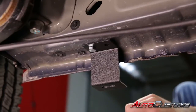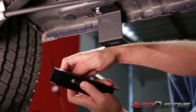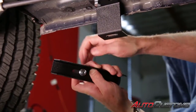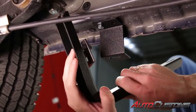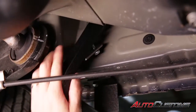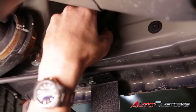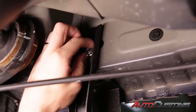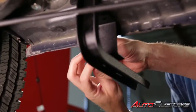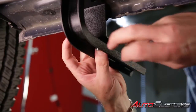Now that we've got that support in place, I'm going to show you a trick with the bracket and the T-bolt. We're going to run that T-bolt through and just thread the nut on just a little ways, that way we can push the T-bolt out and drop it into this oval-shaped hole right here. Then drop our last 8mm bolt to marry the bracket and the bracket brace together.